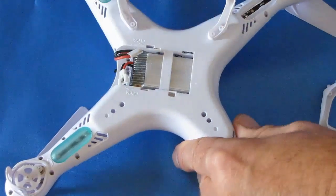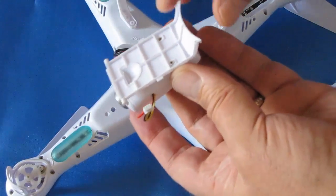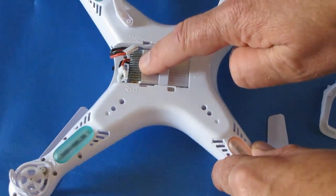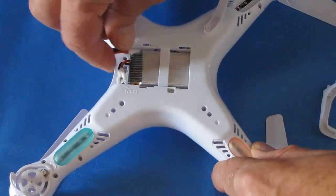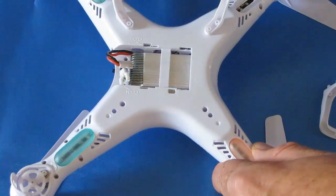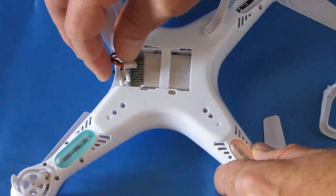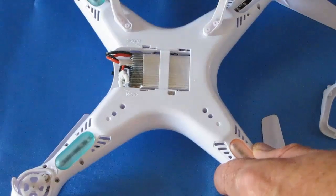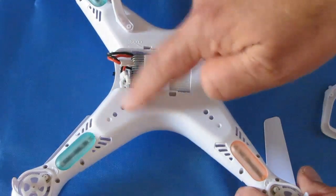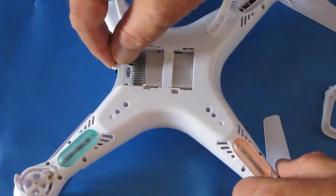There — I've removed the entire camera and door from the quadcopter. Now some of you might be wondering: won't the battery slide out? Well, the power plug when inserted in its slot will in most cases hold the battery in place. I've modified mine to route the power plug externally for a better connection — you can do this by removing the screws on each arm, popping it open, and pulling the power plug out.